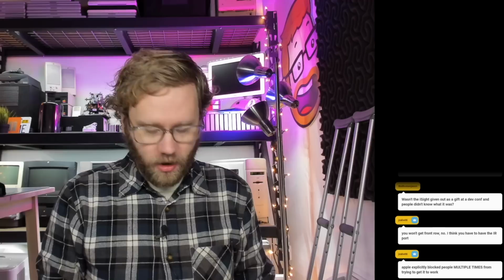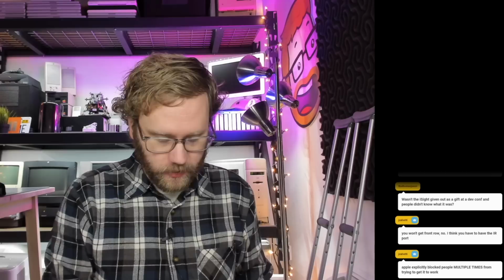Well, this says it's got 45 minutes left to install. This install is really not any faster than it would have been on a hard drive, probably because of the optical drive, but I'm very curious to see how it runs. My general rule on these older machines is to match the OS with the processor. So like 10.3 on a G3, Tiger on a G4, Leopard on a G5. But this machine will run Leopard probably better than ever because of this SSD, but it was a little slow running Leopard on the spinning hard drive when that was here. So you can see that it is installing with about 45 minutes left.